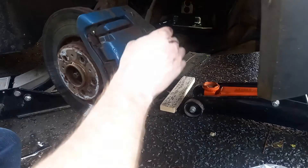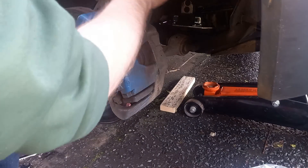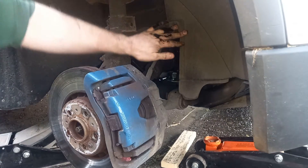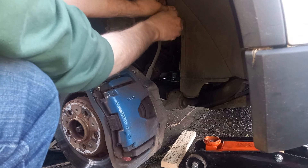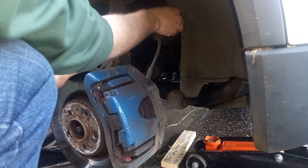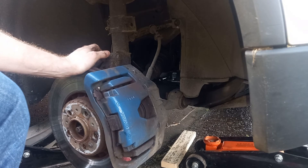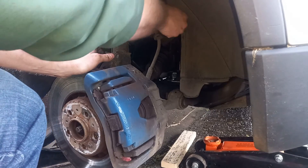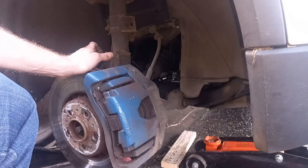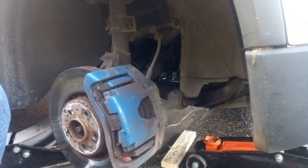Not really that scary a job. Take the vice grips back off, replace the plastic nut, put the wheel back on, and that's it — job done. The rear engine mount on a Volvo. This is the P2 platform, so of course that's the S60, S80, V70, XC70, and XC90 — there may be others but those are the ones off the top of my head. Let's put the wheel back on and take it for a test drive. Thanks very much for watching guys, take it easy, I'll see you next time.